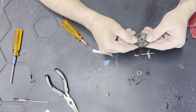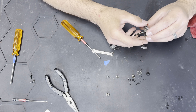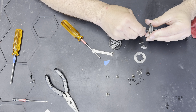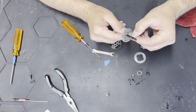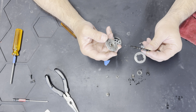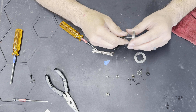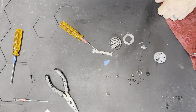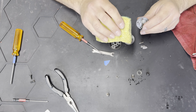Here are the pads — all the pads right there. This is the pressure plate assembly, not looking too bad, just a little dirty. This is the input shaft — if you press on the input shaft, you want to make sure it's straight. I've seen these get bent or stuck so you can't get them apart — this one's obviously in good shape. Now let's get the input shaft and pressure plate nice and clean. You can use a sponge with the rough side — a Scotch-Brite pad — don't use sandpaper because this is just fine.